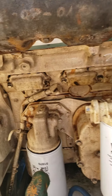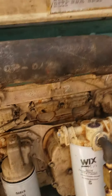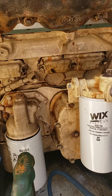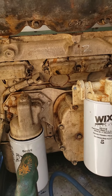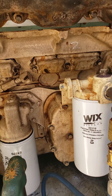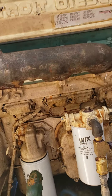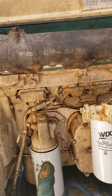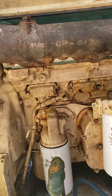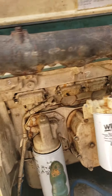I'm going to crank it once without the cutoff solenoid engaging — I don't want it to ignite in case there are any problems. I've already hand-cranked the motor a couple of times to make sure there's no obstructions, but that doesn't cover high RPM. So the next step is to disconnect the fuel rail and just crank it. One, it'll prime it. Two, if there's any mistakes made, it won't hydro lock and bend a piston rod.